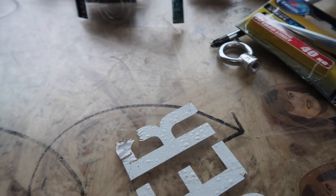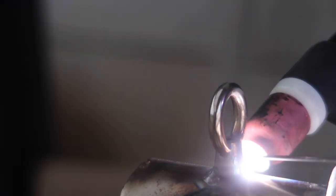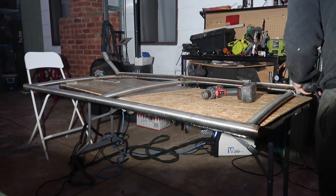Those eyelets there are from Bunnings — they're the M6 type and they're rated to 40 kilos. When you weld them, I think the ratings are probably going to go up. They're a very simple way to create a tie-down point. Just stainless M6 filler wire — weld them about 200mm out from the center of where the bike's going to mount, so the turnbuckles can mount from that point back and onto the forks. That was a pretty straightforward job. Now we're welding all the clamps to the longitudinal rail and cleaning up the edges.